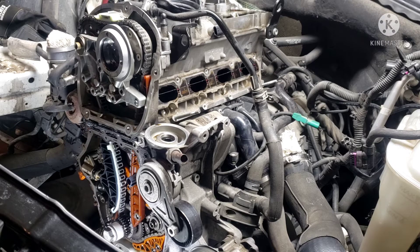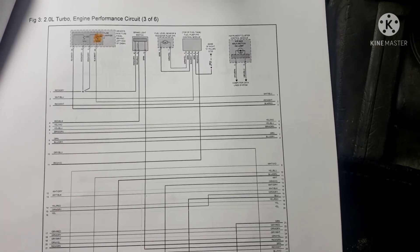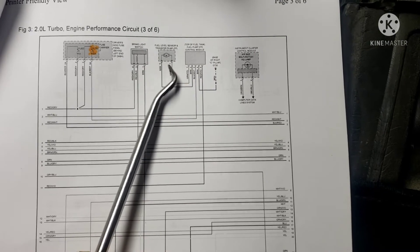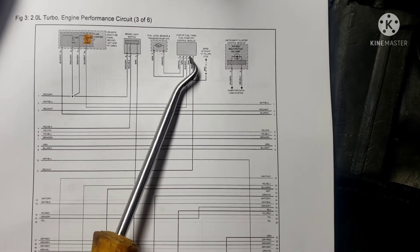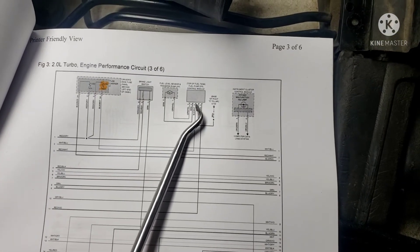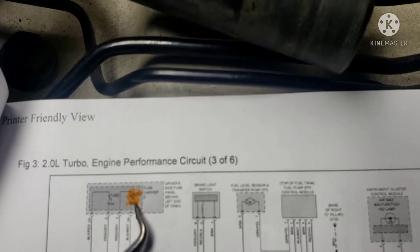Now we're going to try cranking it with a starter motor. Basically what you need to disable is the fuel pump - you don't want the fuel pump running. I'll show you where the fuse for your fuel pump is. Before we get to the fuse block I'll show you a diagram so we can get a better understanding of which fuse and where it is. You can see right here this is the fuel pump, and then there's a fuel pump control module with power and ground going to it. There's a wire going to the fuse, a wire to ground, and the fifth wire goes to the ECU. So what we're going to do is disable this power - fuse number three, 25 amp, on the driver side fuse panel.